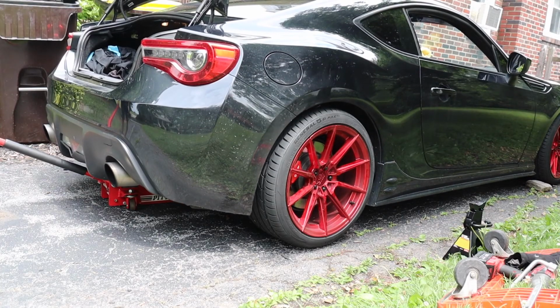Now, on the backs, I did them 4. So the front I did 5.5 full rings around down, and the backs I only did 4 because the back was already pretty good fitment, so I might be tucking mad tire now, I'm not too sure. So I only did them 4 times. I'm expecting it to be a lot different because I still had a lot of preload left in the back. So let's see what we got.